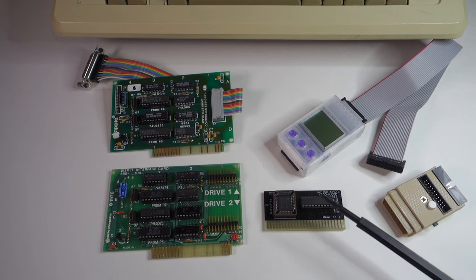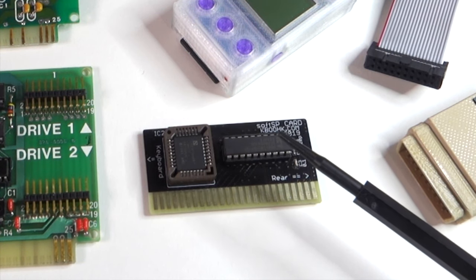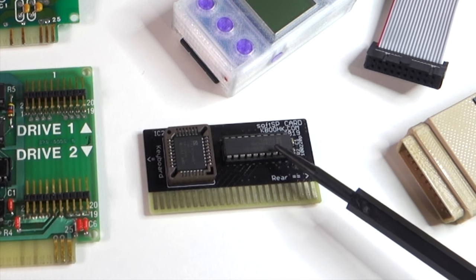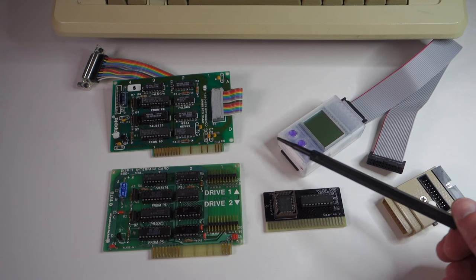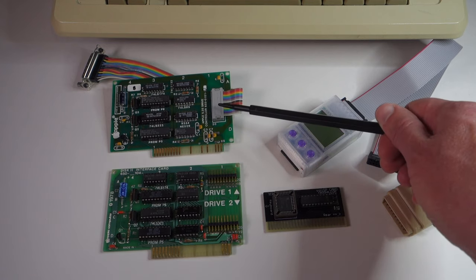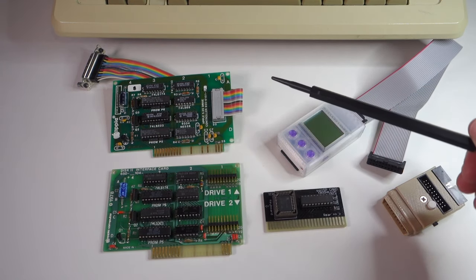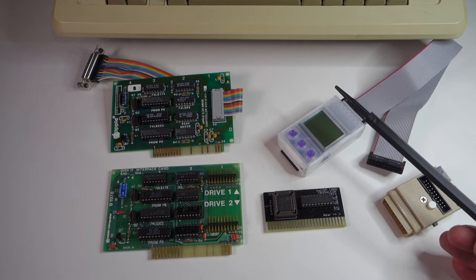So to solve this, Kaboo has come out with this Soft SP card. What this card does is on an Apple II, 2 Plus, or 2E, you just put it into any slot and it will trick the computer into thinking it has SmartPort support. You can plug your W-Drive into a normal Disk II card or into a 5.25 drive card with an adapter, and it'll actually be able to boot up 32 megabyte images.